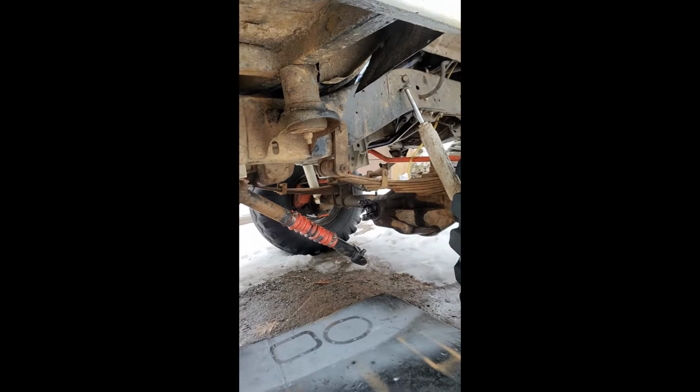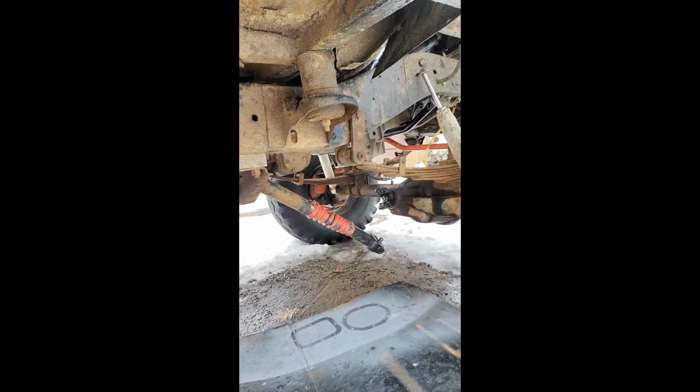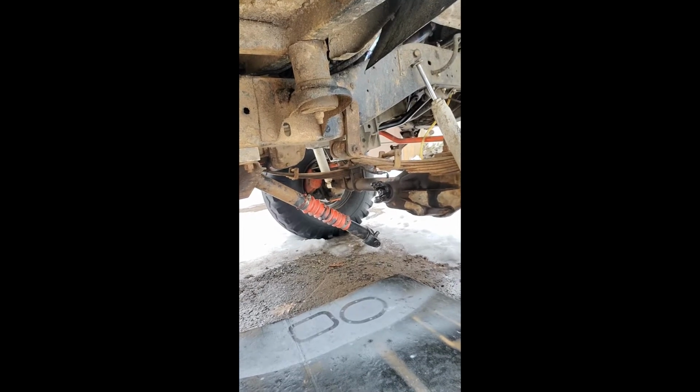So, I know you guys have all heard the saying, it's always something. Well, last night, I went to take a drive and my drive shaft fell out. The hubs were locked in, but it wasn't in four-wheel drive. So it rattled and then, yeah, it came disconnected. Normally I wouldn't care because I do have a new drive shaft going in. It's got to come out anyway, but the crap part is I need it hooked up at both ends in order to get the bolts loose. So once I fix that, I can put the new drive shaft in and be good to go.